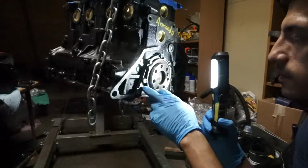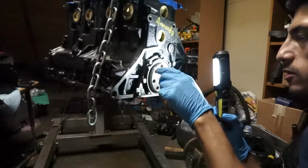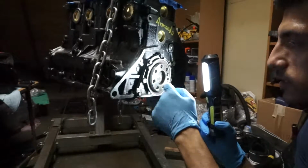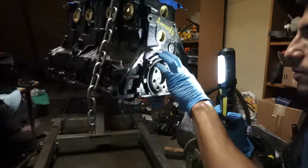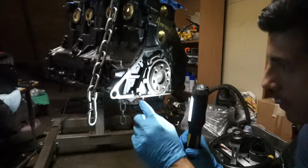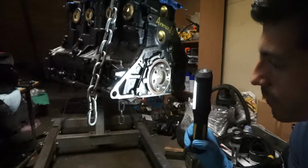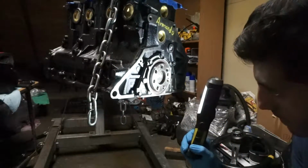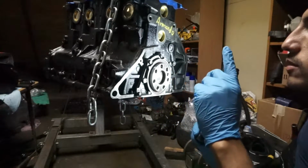So the rear main seal is in. I used the OEM seal. A little bit of assembly lube right here, just so when it starts cranking over there's not that much friction. And then just enough sealant. I didn't go with the gasket this time, so I just went with the 3-Bond. Torqued them down to 8 pounds, and it comes out just a hair. So let the bead do its work, or the RTV do the work. No need to cream it or cake it on there. So it looks pretty cool. Now I'll put it back on the engine stand and we'll do the head.